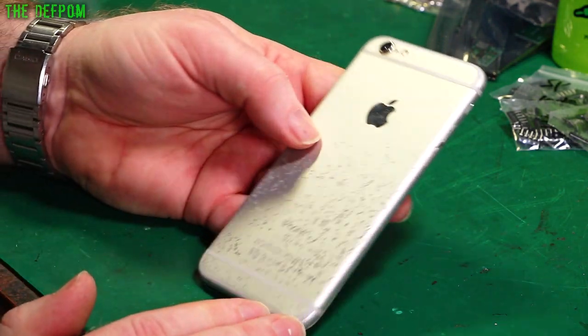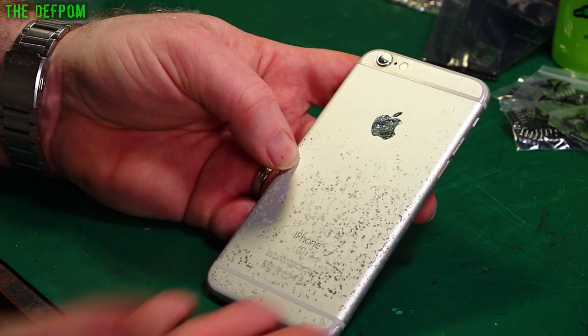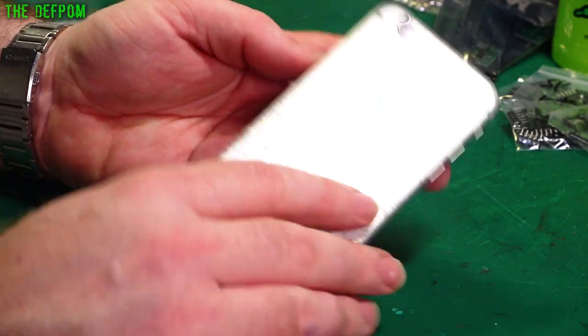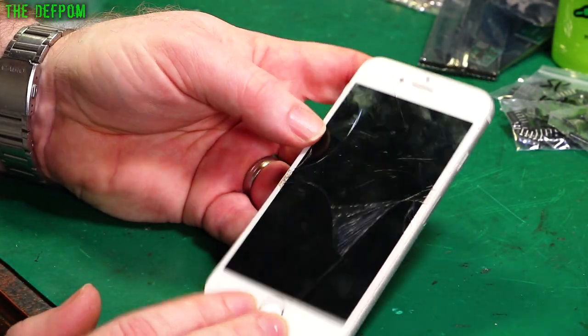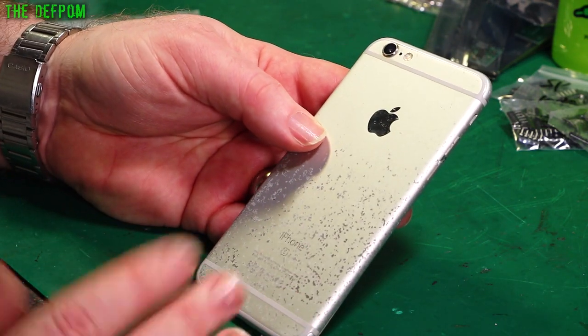You know, you can buy a liquid damage phone or something which has been iCloud locked or whatever. As long as it's got a decent chassis, you can transplant most of the insides over into the chassis and not have to worry about it. Then you've got a rubbish chassis with a locked board, it doesn't matter. Then you can use that locked board for parts or whatever.